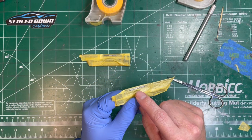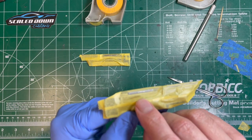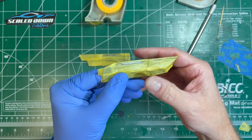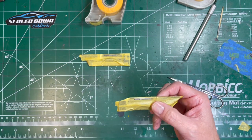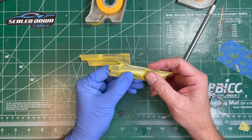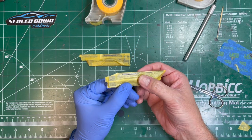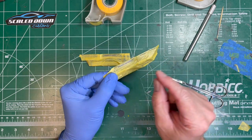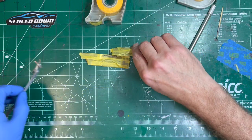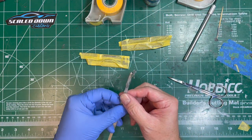All right, so after I did such a fine tape job on the chrome panels on the door cards, I even highlighted the chrome trim with chrome. But after I realized that, I realized it's more of an aluminum look, and that's not the look I'm going for. I want more of the black chrome look, and as you can see, that doesn't really match up. Then I realized that I had sprayed the black chrome over the semi-gloss black, and I sprayed it on way too thick, like I would any other paint color, instead of dusting it on lightly and building it up on a gloss black background. So I've got those taped off and I'm gonna repaint those gloss black and then black chrome them up with the black chrome again.